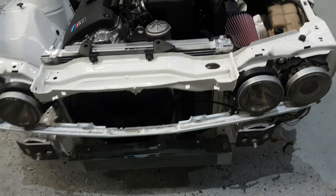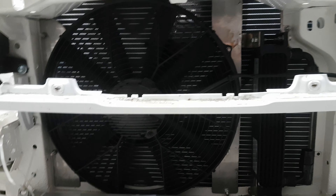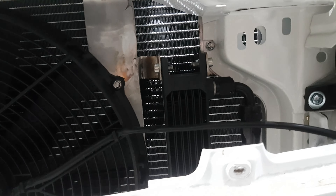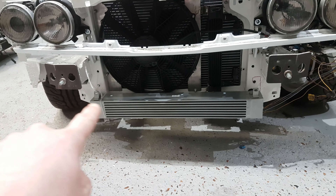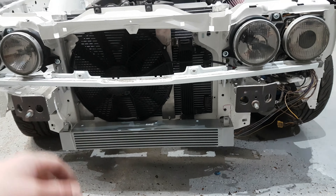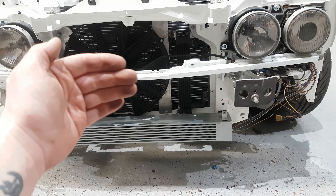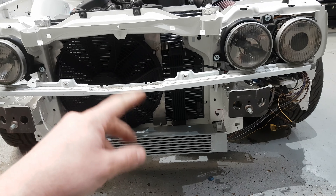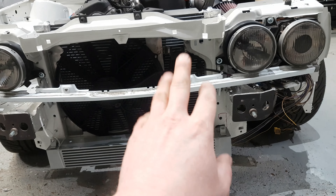He's also been mounting all the lower parts of the front panel. You can see there are some stainless steel mounts made in the front panel itself. They're all bolt-in — nothing's been welded — so the little oil cooler for the power steering is now bolted into the front panel. He's now in the process of mounting the engine oil cooler. The coolant fan is on that side of the radiator to meet the hot water as it comes in. The cold water works its way through the radiator and exits on that side. I always mount the fan over to the hot side and expect the airflow of the front panel to keep the other side even cooler.